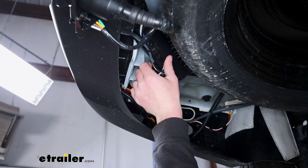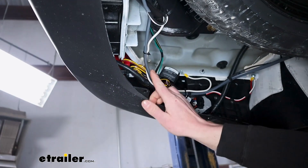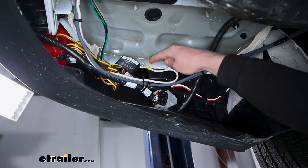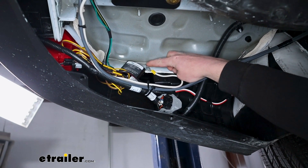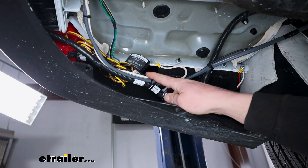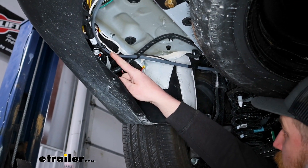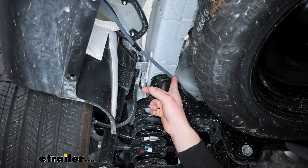I went ahead and used some electrical tape on all our connections and zip tied it all up. The duplex wire as well as our extended ground wire runs up through here. For the ground wire, I used the provided self-tapping screw and attached it to this piece of the frame. When you attach a ground wire, you want it touching clean solid metal, so this is a real good spot. With that, our duplex wiring can now start to route towards the front of the vehicle, since it's going to go up into the engine compartment — flowing up through here and above our subframe. When routing your wiring, be sure to avoid any hot or moving parts.